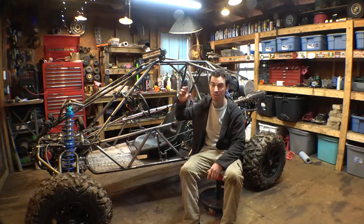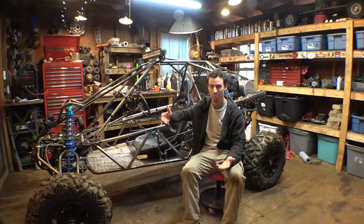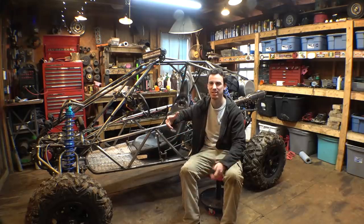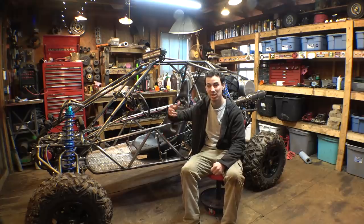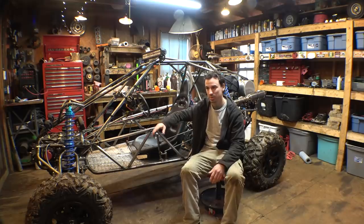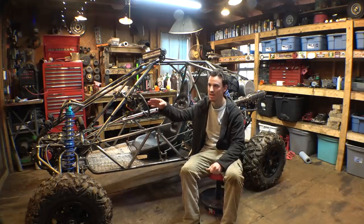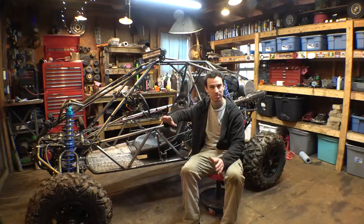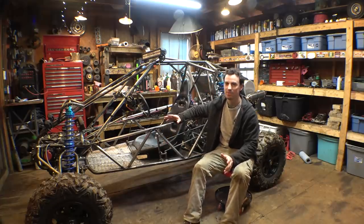Also, I was pressurizing the radiator. It was holding pressure. It would hold pressure for like 20 minutes. And I kept filling it back up, and now it's finally holding fluid. I think it was just air bubbles getting out of the coolant system, and once I ran it, it got a bunch more air bubbles out. I ran it again yesterday for another 5 minutes, let it cool down for 2 minutes, checked the radiator, and it was the same level. I did that 3 times and the coolant level was still the same, so I think it was just a false alarm.